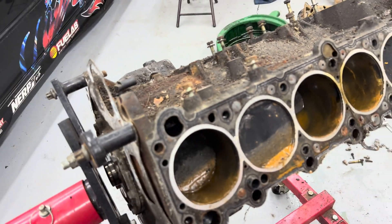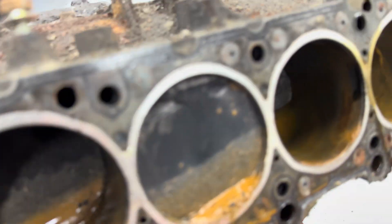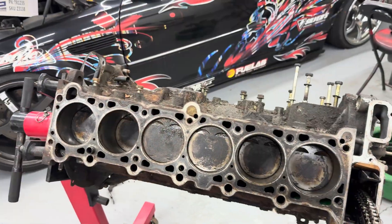There's the bottom end. Head gasket — paper, still intact. Let's get this thing pulled apart. The last clip I took was the pistons with the head off. I'll flip the camera around to go over the cylinder wall condition — though it doesn't really matter much since we're boring the motor over. We're going to be doing 84.5mm pistons — I think 85mm or 84 and a half.